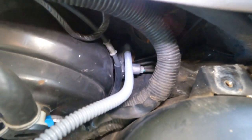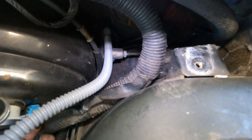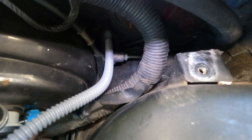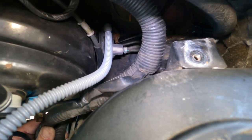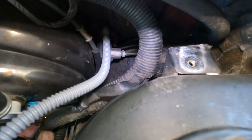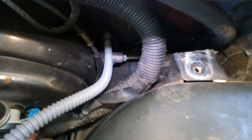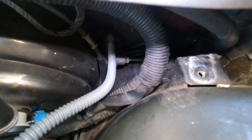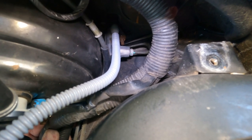There's a little line down there - that stupid thing is an 11-millimeter, because apparently 10 wasn't good enough. So I'm going to back that out, disconnect the line, and drop it out the bottom to get it completely out of the way, because there's no way you're going to struggle that thing out through the top with the line on. There's no angle to record it, so stay tuned.